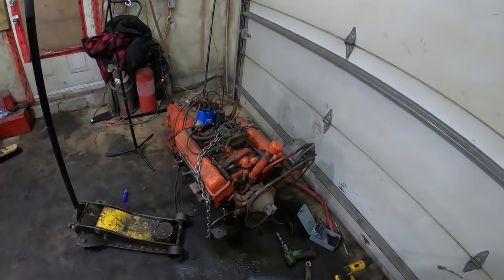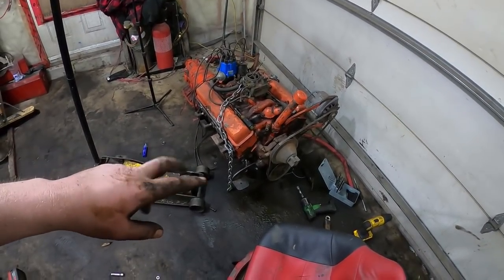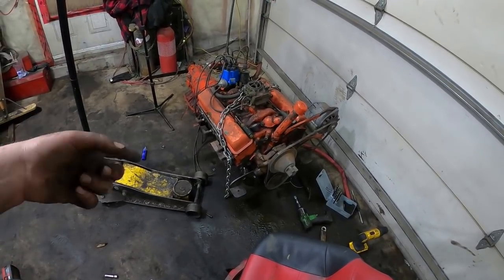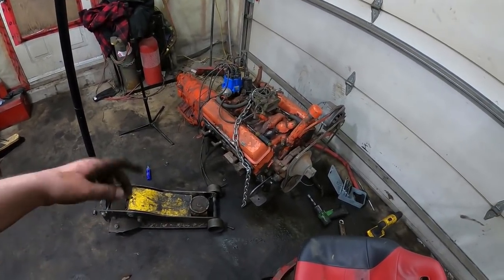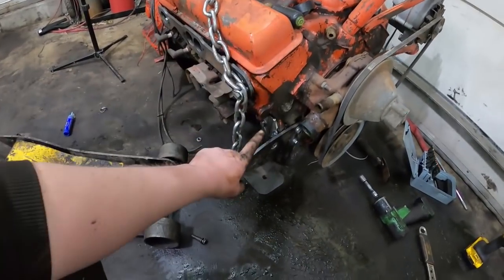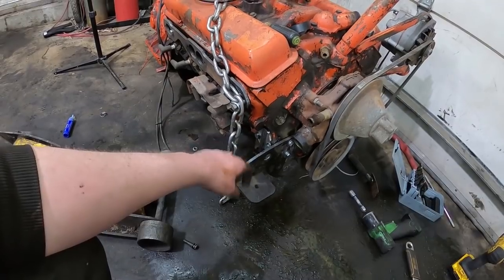All right, so I got the miscellaneous hoses and stuff like that off. The plate's on where those two bosses are, where I just drilled them out, so it's super simple. 3/8 is a 5/16 drill bit, so zip zip, and then I tapped it, cleaned it out with some brake clean, nothing went in there. You do have to lose the fuel pump because it won't fit with this front mount, so I had one of these block off plates, so I just put that on there.